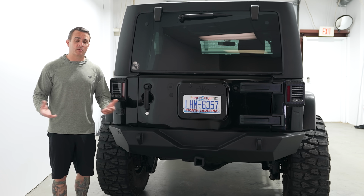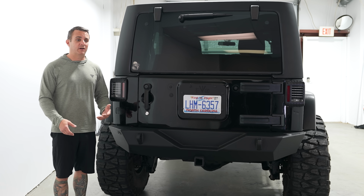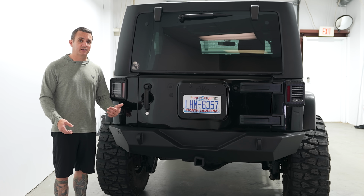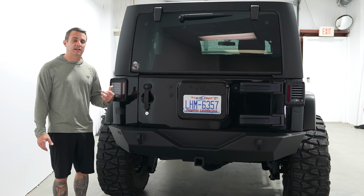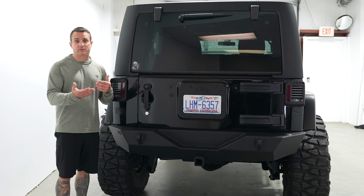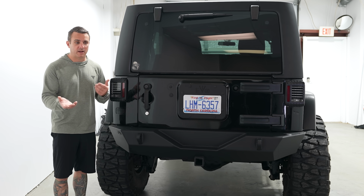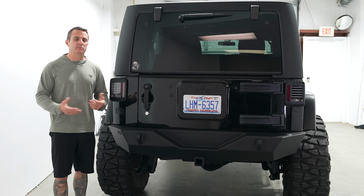Yes, if you cut a sidewall, it's a pain in the butt, but there are things like glue tread out there that all you really need is to be able to scuff the outside of the sidewall. You put your glue tread on and you're good to go. If you've got a bead lock like I do, you can always take apart that outside ring, get in, hopefully if it's inner, or it doesn't really matter, outer, and you can actually seal it that way. There are ways to get off the trail and get home if you get a flat.